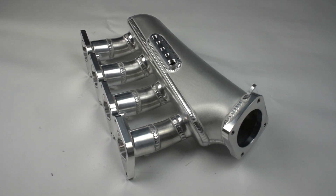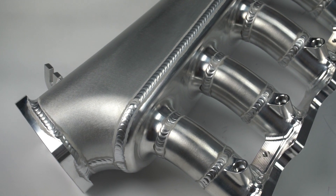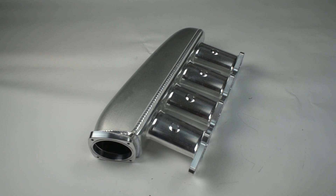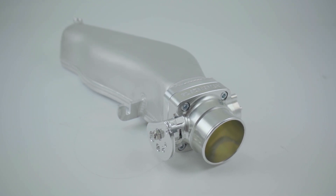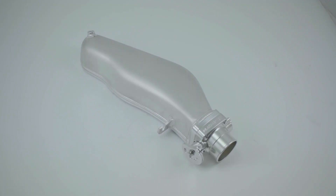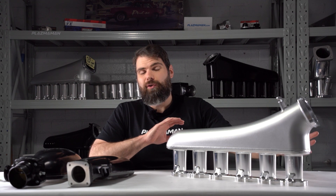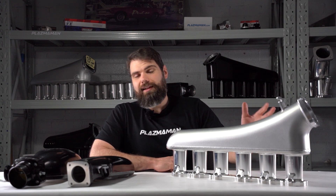Plenum volume and shape also play a big part in the performance characteristics of your intake manifold. The theory behind plenum volume and shape design does have a lot of ideas out there, but the fundamentals remain the same. If a plenum dome is too small, it can cause real sluggish performance down low — the engine just can't get enough air. If the plenum volume is too large, this can cause air to be slowed when it enters the plenum, causing poor air-fuel distribution to all cylinders and sluggish engine response. So a lot of care has to be taken when designing an intake plenum dome.